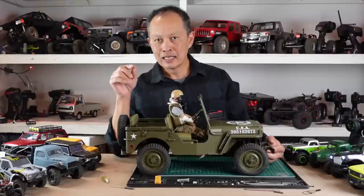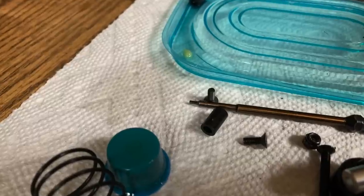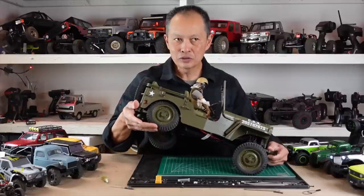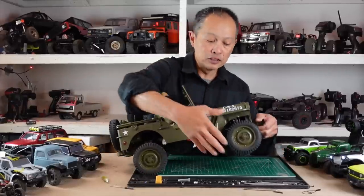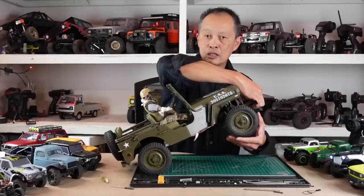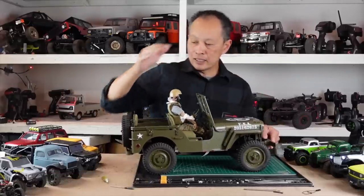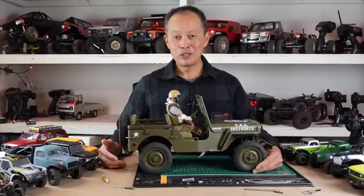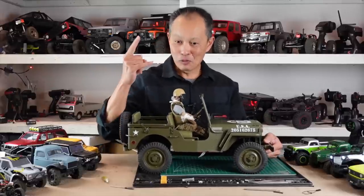Fix the shocks - dump all the shock oil, clean it out. Make sure there's no trace of that poison, that cancer, and put new shock oil, 25 weight, put the green slime where the seals are. And while I was at it, I found these 10-millimeter shock limiters. What shock limiters do is they stop the action - I think 30% of the action is stopped. Take them out, at the very least on the rear because there is no interference there whatsoever. And you get articulation.